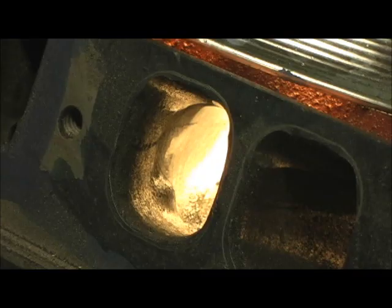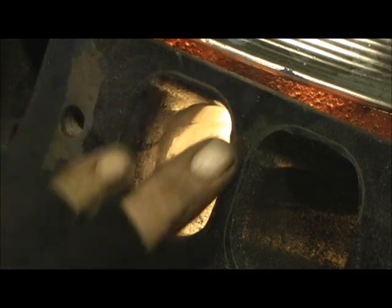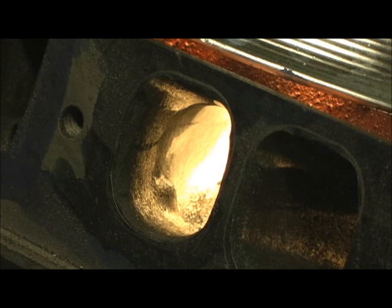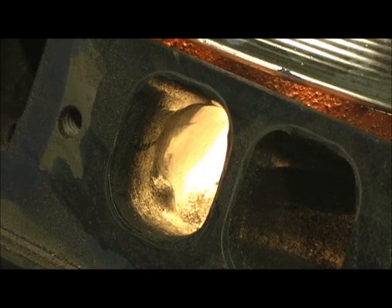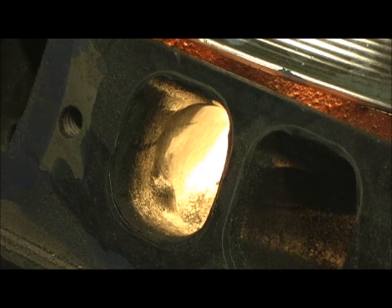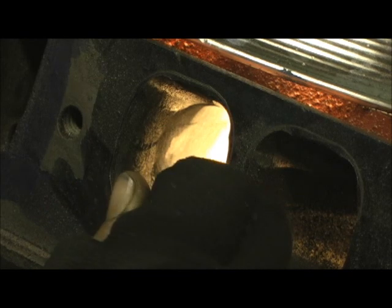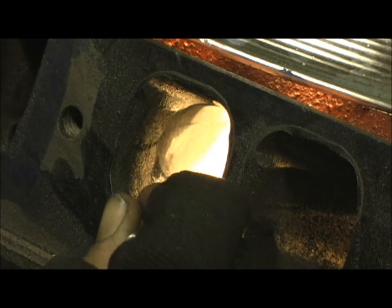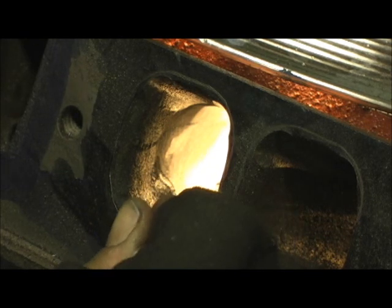We're on the roofs now. Although I've already showed you how the cloverleaf bottoms are done, this top one has got something special going on — and I say special in a lighthearted way. What we've got here is a big imbalance problem on what I call the hook port. Look at that giant bulge — that's for the rocker stud. This right here is a serious flow disruptor and one chunk of meat.